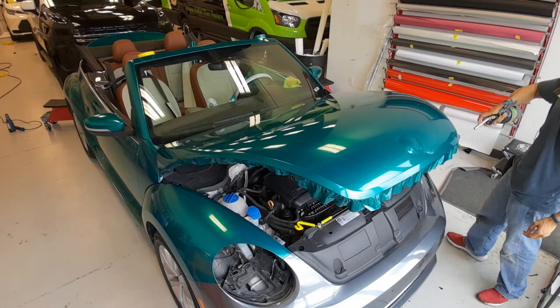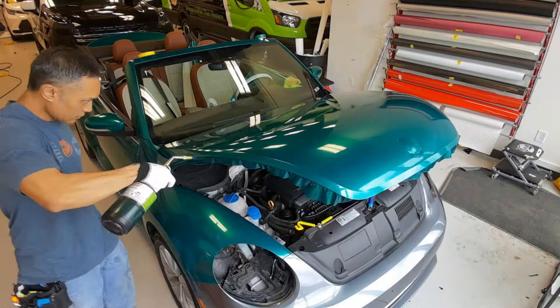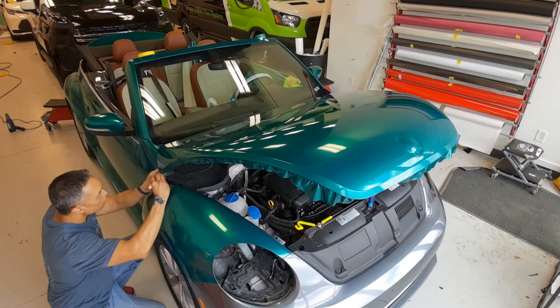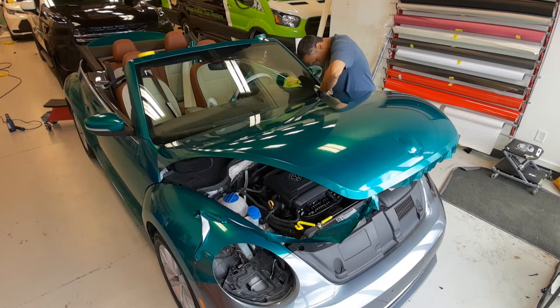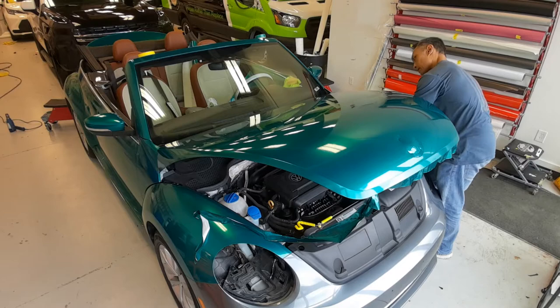Now I'm just giving it a little bit of heat all the way around — basically, if there's any stretch, let that stretch come back and make sure it wraps and sucks itself down over the edges. Then, while the vinyl is warm and a little malleable, I'm just rolling everything over underneath slightly so that it has nice good coverage over the edges of the hood. That way it looks like paint from no matter which angle you look at it, even when you lift up the hood. I'm trimming off that excess vinyl holding just a little bit of tension with the side of my blade up against the underside of the hood.